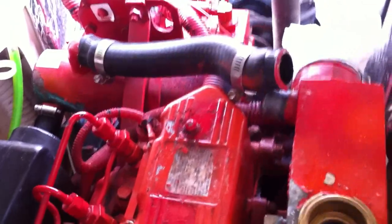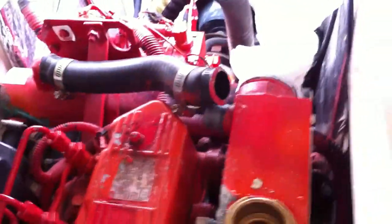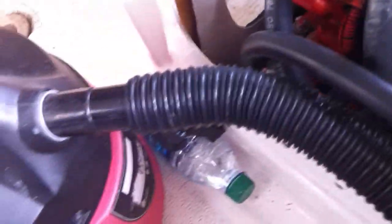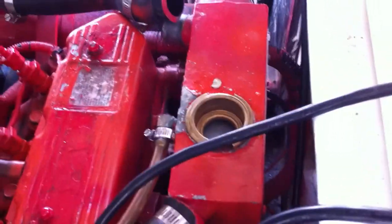If you're going to change the coolant or work on the hoses, you really don't want to spill the coolant all over the place. There's a trick to this - use a shop vac. Here's the wet dry shop vac. I took the filter out, of course, so it's just going to pick up the old coolant. Put it on right up here, suck all the coolant out. I'd already taken most of it out, so that's how you do it.